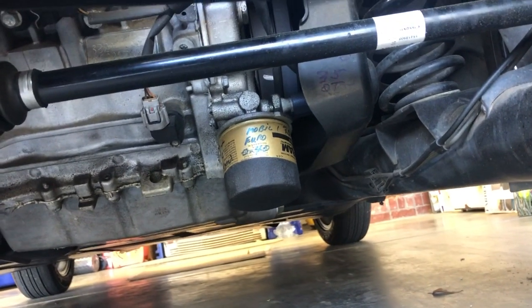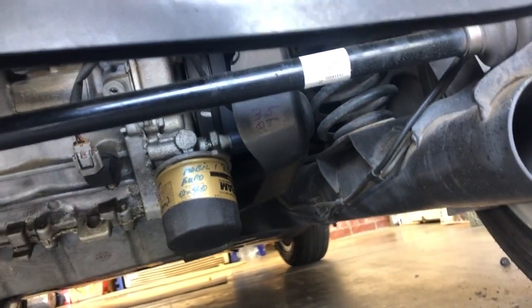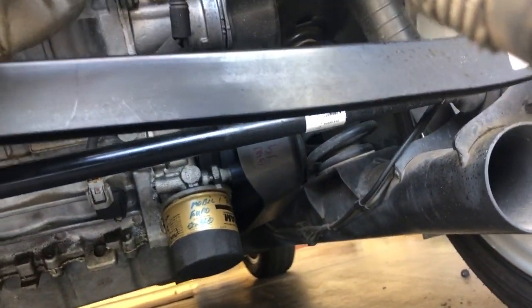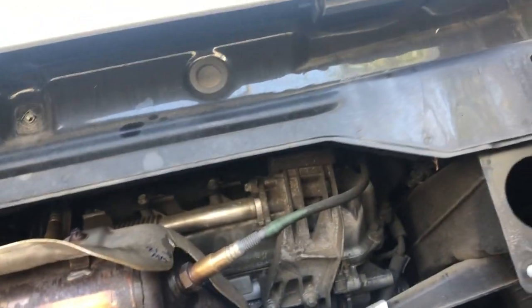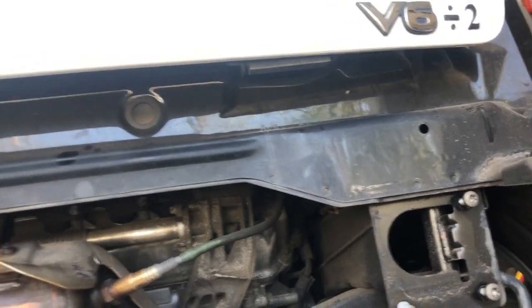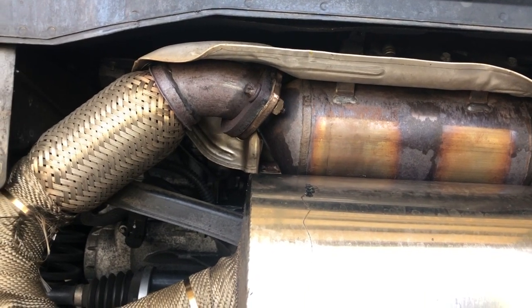You can see there's the oil filter right there that I recently changed. I'm using Mobil 1 with 0W40 oil. Pretty easy to change it — there's a drain plug off there to the right, and typically you don't even have to lower the car. This is a pretty simple system, and the sound is really going to be good once I go ahead and replace this header system.